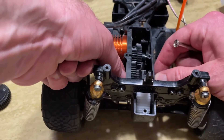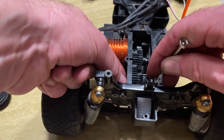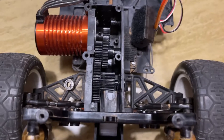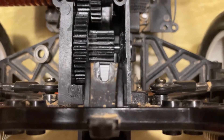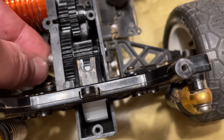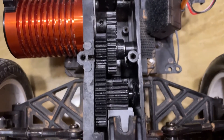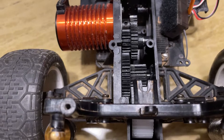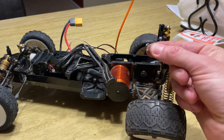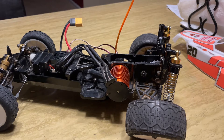Once that's in there, I should be able to slide it into the gear. Perfect. I was getting a low battery warning on my phone, but there we go — the metal pin, I slid it in there. Then I have to slide this bearing back on here. This gearbox does not inspire much confidence — it feels very much like a toy, especially after looking at my son's Bandit or even my Ultima. Now I'm going to throw that C-pin back in there, and then reinstall this C or E clip — whatever it is. This can be very tedious. Next in goes the idle gear — again, this is the 32-tooth idle gear.